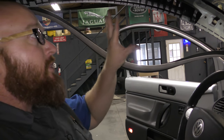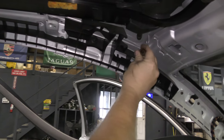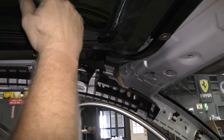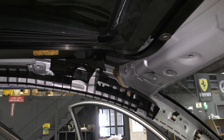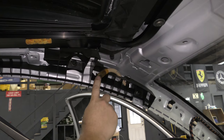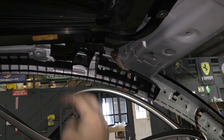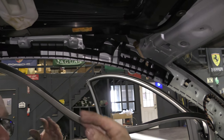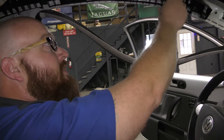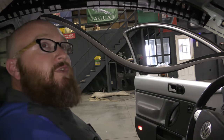This is also a good time to clean your sunroof drains, which are right here — this little hose. When water fills up here from rain, believe it or not, no car on earth has a watertight sunroof. That's why they have a drain pan and drain tube. These frequently get plugged with debris and can't drain to the ground anymore, so it starts overflowing into your lap. Take compressed air, lightly blow these out, clean out any debris, and place them back on. There are two of them, one on each side.